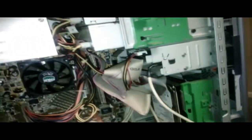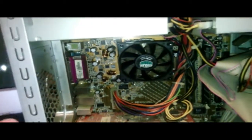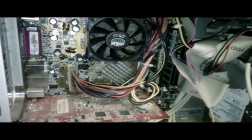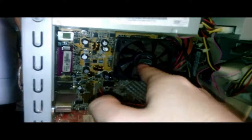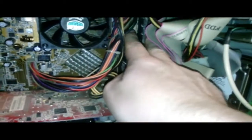Sometimes computers can power on and have different problems. If you go to power on the computer and there's nothing — no lights, not hearing anything spin up — then you have what I refer to as a no power on. If you power on the computer and you're getting lights and hearing things spin up, but not getting anything on your monitor, that tells me you've either got a blown video card, a problem with your processor, or a problem with your RAM. If your processor is out, you're not going to get anything anyway — though some computers' BIOS can give you an audible beep if there's a problem with the processor.